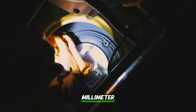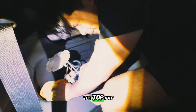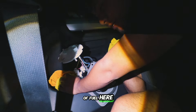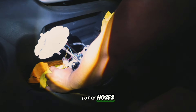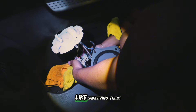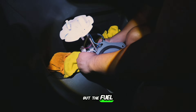A little bit of fuel spilled — not too much. You're then going to remove six 8-millimeter bolts around the top hat of the fuel pump. After you remove the top hat, the last thing is taking out the actual fuel pump. One mistake I made — it's better if your tank is on empty because you don't have a bunch of fuel here. I accidentally overfilled it so this is about half a tank in, but regardless just wiggle your way around the fuel pump.